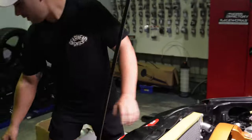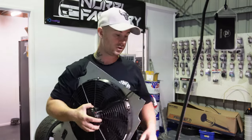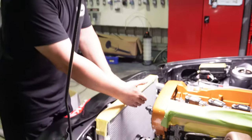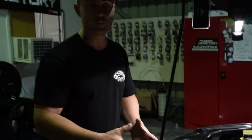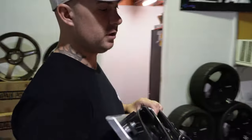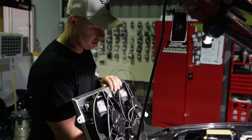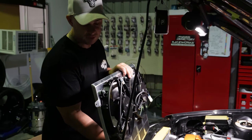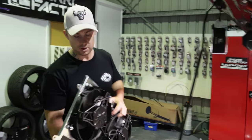The reason we couldn't run the Frenchy's Performance Garage fan shroud is it hits on the Barnes external oil pump and also the power steering. When we contacted Hypertune we told them exactly what we had - the big Barnes external pump - and we just wanted a radiator that could fit and have the cool fan shroud with smaller fans to accommodate the Barnes pump. Worst luck, it hits on the power steering. This radiator is for an R32 GTR - why is it hitting on the power steering? It's put us in a really hard spot because in five days we're meant to be on the dyno.